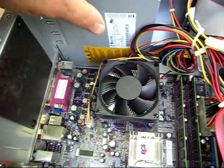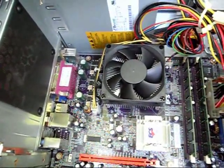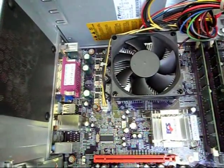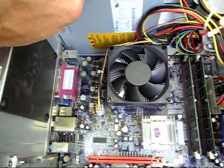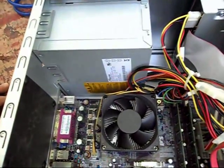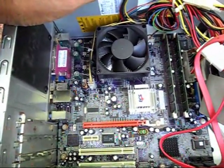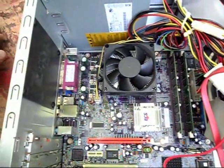It could be some bad caps in the power supply too, but my experience is just change the power supply — the computer shop I deal with just changes it. I had a problem with my son's Acer — the real skinny vertical job — it needed a power supply. They opened it up and couldn't find one bulging cap in it, but the power supply was nevertheless bad. So you can't always go by that, because a cap can still be bad even if it isn't bulging. If this were an antique radio with bigger components spaced out more I'd have no problem, but I don't have any equipment or big magnifiers for this small stuff anymore.